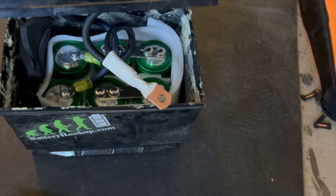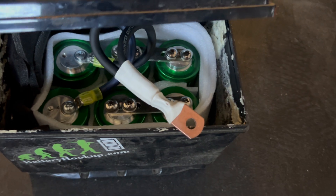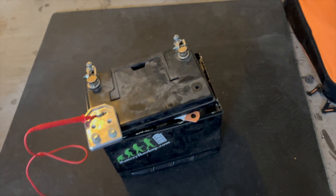I've already dissected it a little bit. No visible damage to any of those cells, but I think one of them's bad. Anyway, since we're going with the Headway cells, we're keeping with the Headway lithium. Those can be run in parallel with AGM batteries with your factory charging system. So we're going to do an AGM under the hood and a Headway bank in the back.